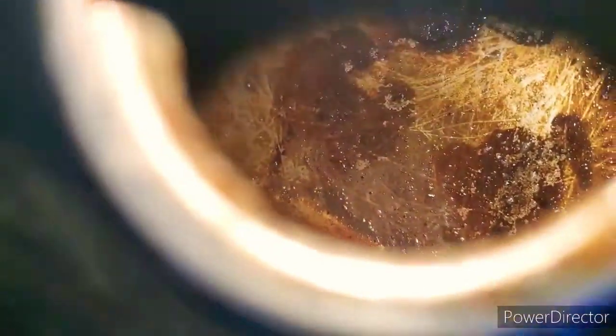There is a lot of rust in the gas tank, so hopefully we can try to get it penetrated and clean it up. For about a week now I've been working on the Kawasaki to get it running. We ran into a problem with the carburetor — the gas tank was really rusted out and we couldn't figure out how to retrofit anything with it, so we just went with a Mikuni 24.